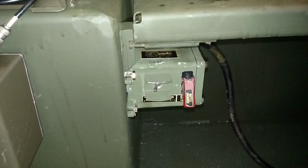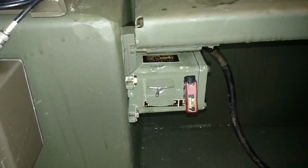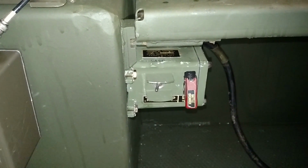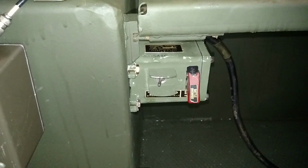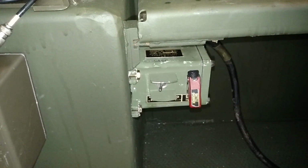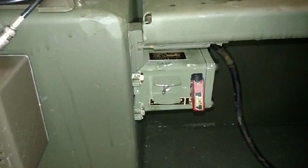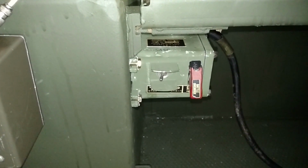And I'll tell you what this thing is used for. This is going to help to control the spikes to your electronic equipment, like your radios and intercom systems, or whatever you might have that you're powering. And what this is, or where it was mostly found, is in armored vehicles with some kind of hydraulic system. And with these hydraulic systems, it caused power surges that would destroy different types of electronic components. So, is it needed in the Gamma Goat? Probably not, but like I said, it's extra insurance.